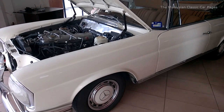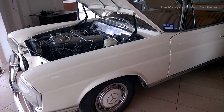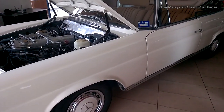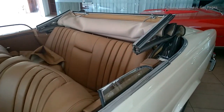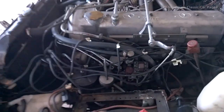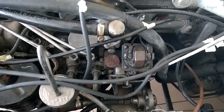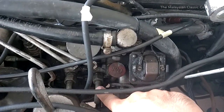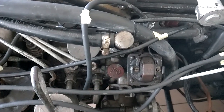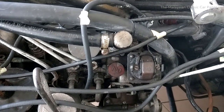What we're looking at here is a 220 SE. One thing that can be quite confusing is that the car has two pumps. At the back of the car there is an electric fuel pump, and its purpose is to transmit fuel up to the second pump, which is the fuel injection pump. Fuel is delivered by the electric pump to the fuel injection pump along one of those lines, and then it returns back to the fuel tank — so it is a recirculating fuel delivery system.